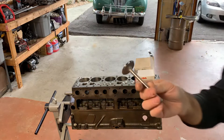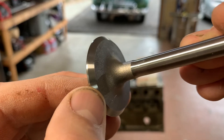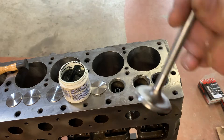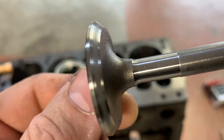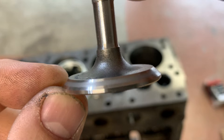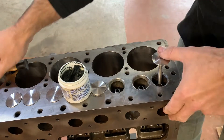I want to show you a brand new valve right now. Look at the end of it — it's nice and smooth, polished to a nice finish. But that's not what we're looking for when we do our valve grinding. Now let's look at the end of this lapped valve — see that nice frosted circle in the center, all the way around? Nice and even in the center of the valve, the valve seat area. That frosted ring is what we're polishing for.